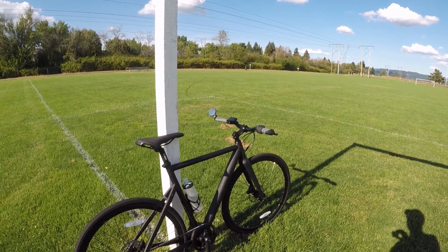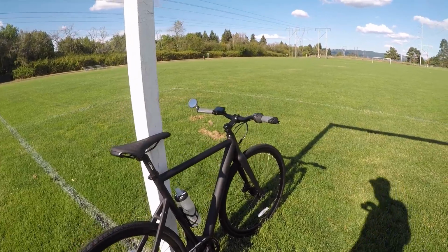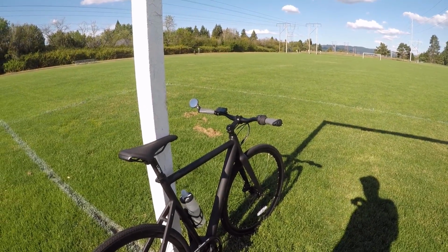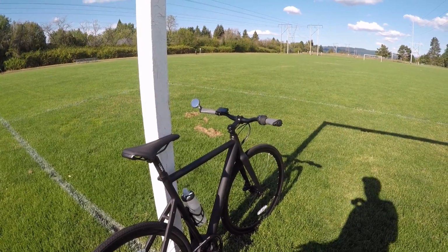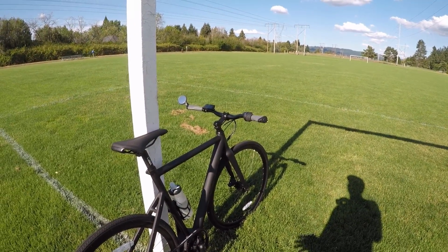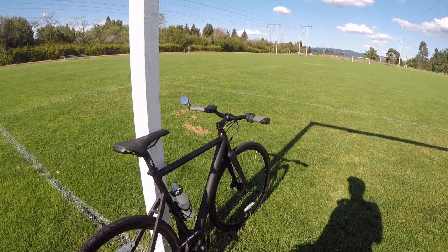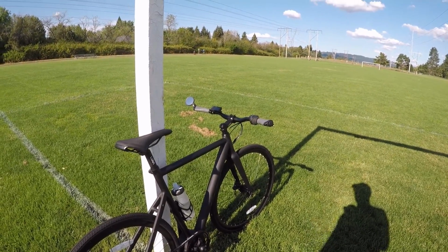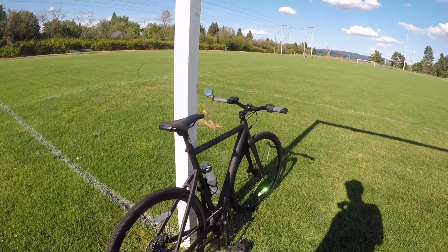That said, the battery is absolutely tiny. I think the second day I did 7 miles on it, I used roughly 55 to 60% of the battery, and that was mostly in pedal assist 2, only using 3 when going up hills. So if you're going to go any kind of distance on this bike, more than say 25 miles in a single trip, you're going to want to keep it in pedal assist 1 or 2 and not really push it, otherwise you will run out of battery. It's a tiny battery, but that's the trade-off for having it be super stealthy.